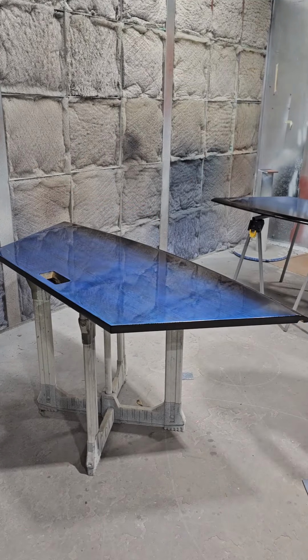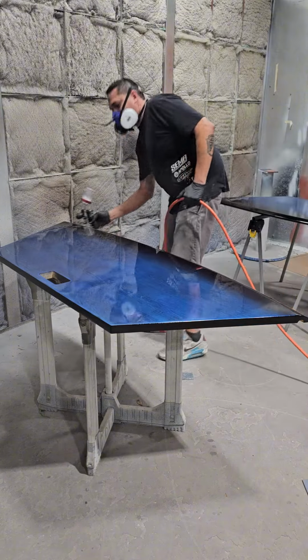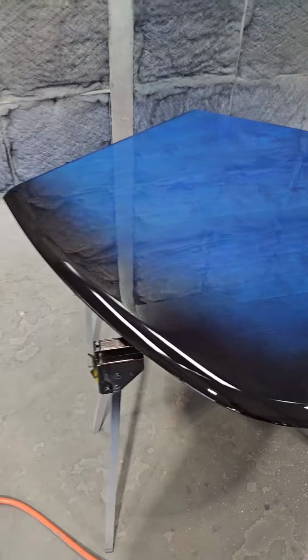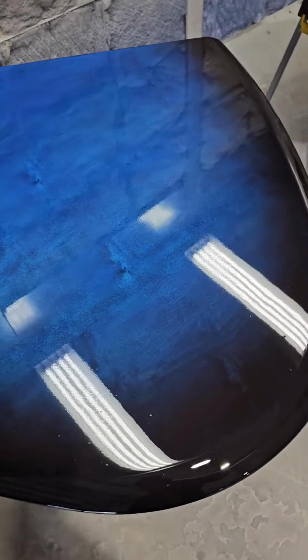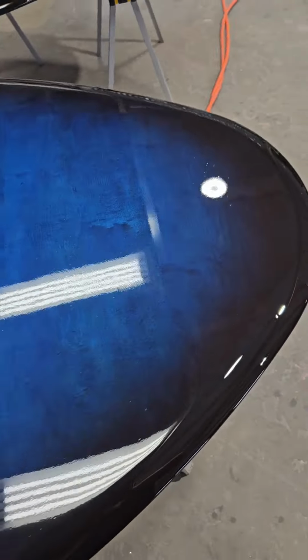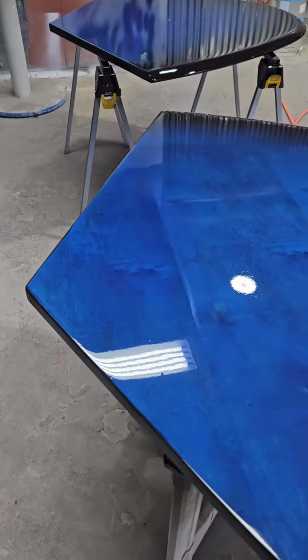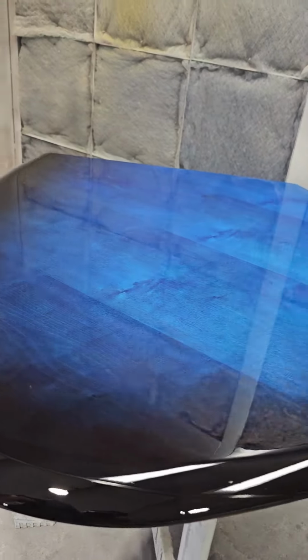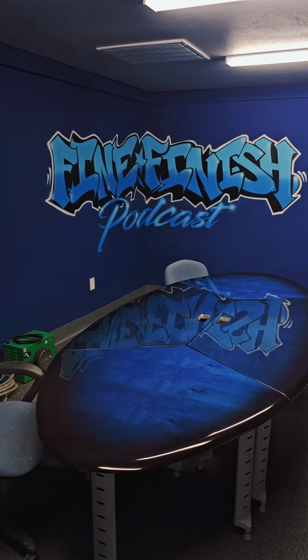And that's what you're going to see here coming up, is after I did the flow coat and sanding and applied that really heavy coat, and it really got it to lay out real nice to where I'm going to have to do very, very minimal sanding, wet sanding and polishing, which I didn't. I went over it lightly with 2000 and then polished it with a Wizard heavy cut compound and a wool pad, and then went over it again with the foam pad.